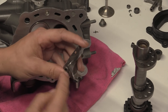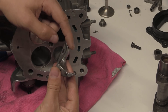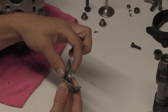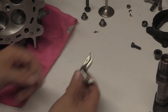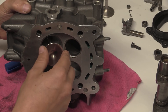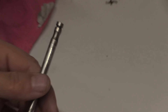As soon as this valve starts to grow with heat, as soon as the cam starts to heat up and expand, it pushes even harder against that rocker. More force to this rocker — but this clearance has decreased because everything has expanded. The collar that rides against the valve expands, everything expands and you have a binding situation. Your valve pops off — you drop a valve. It just pops off that section of the valve. See that collet recess there? There is far too much force and it just pops the head off.